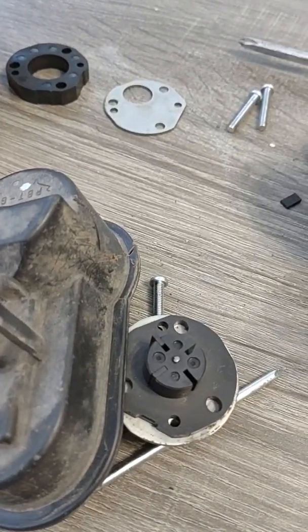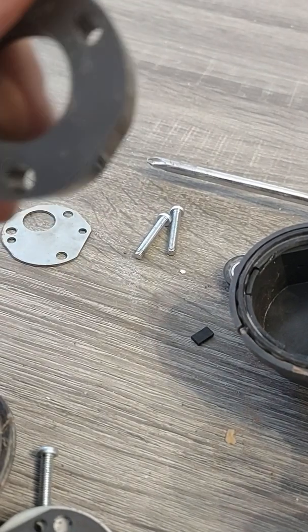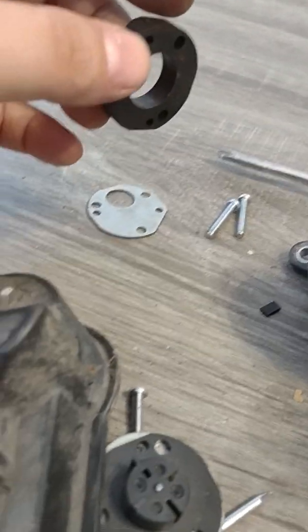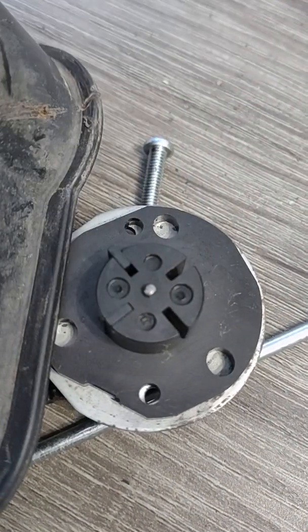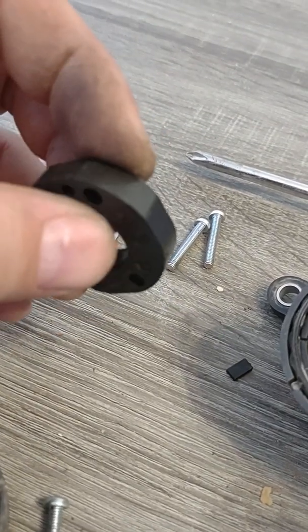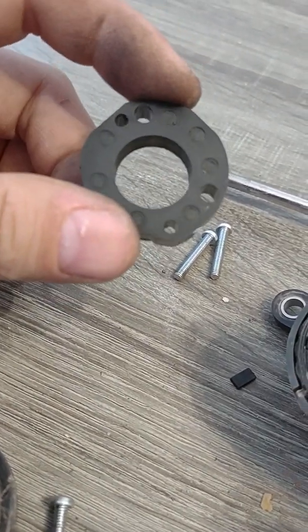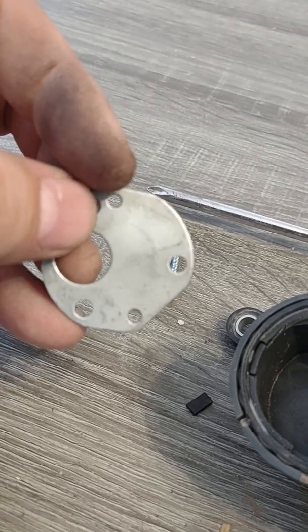Mine was having a hard time spinning. Whatever this material is — it's plastic but it has a weird consistency, carbon plastic something. These little fins are inside here. This is a spinner motor; the motor is in the backside. Basically it spins around in here and creates a vacuum which then goes down in there. What happens is this thing had bits of like fuel hydrocarbon buildup on it, which I've wiped off already. And then this metal plate right here had some on it as well. It was all full of hydrocarbons — like gummy nastiness.